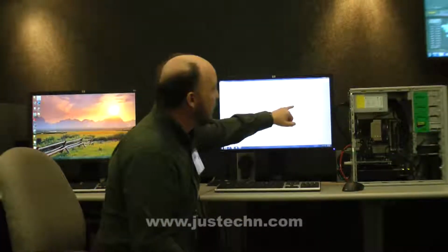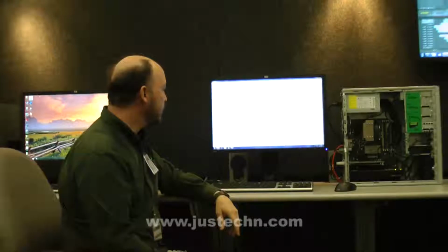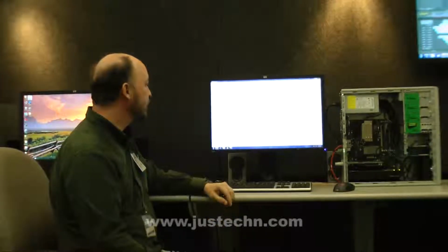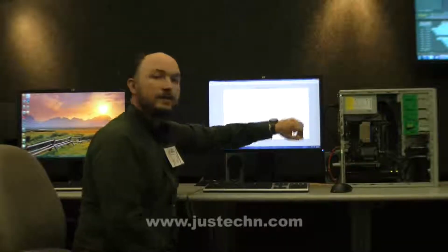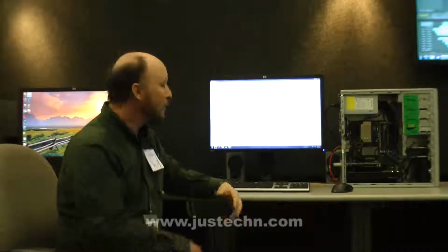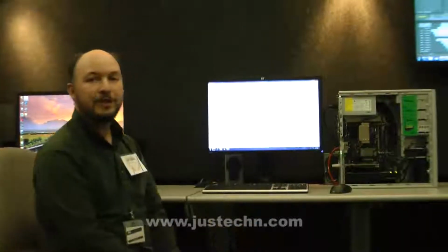The green line at the top here is this product, the C2050, and the red line is the smaller brother, the C1060, also from NVIDIA, another Tesla implementation. And you can see for these big problems here, the C2050 is a little over 10 times as fast as a quad-core CPU. So for this class of computation, GPU compute is huge.